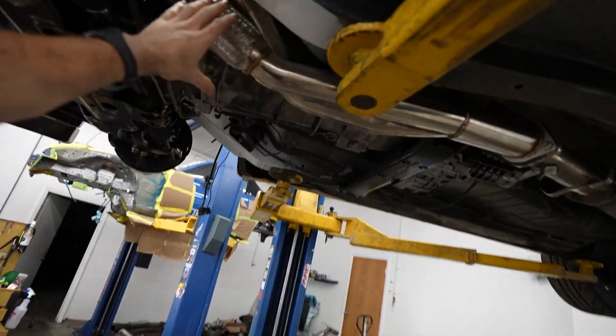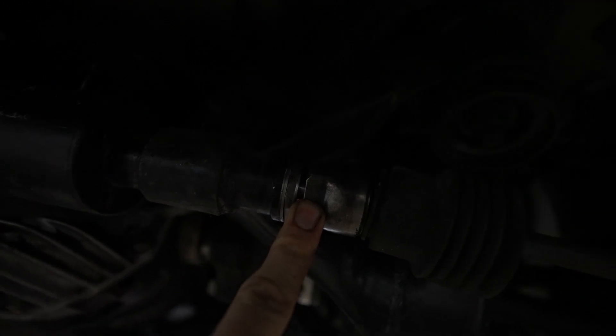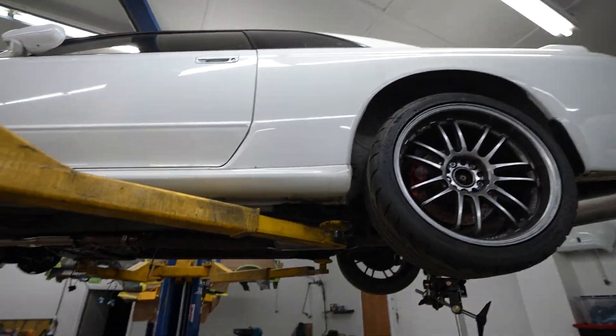Plugging away — the downpipe is basically hooked up, we relocated the clutch line, got the driveshafts in, the rear diff, rear axles. We removed all the HIKAs lines. The HIKAs is basically a rear steering rack that can turn about an eighth of an inch left to right to make the car drive differently. I have a HIKAs delete that was supposed to be delivered today; if it doesn't arrive, I'll just weld that and call it good. Need to weld an O2 sensor bung — marked it, just need to drill a hole and cut off some tabs. The only other thing we're waiting on today is heater hoses.